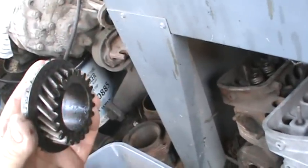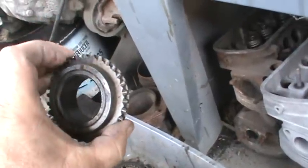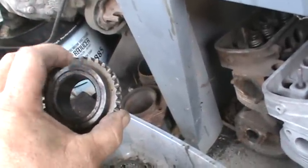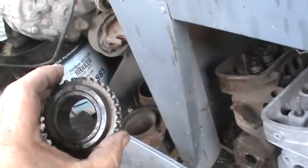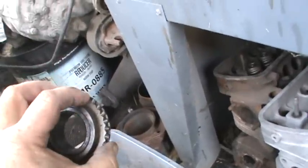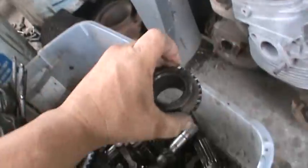If the gear actually drove the car, this wouldn't be an issue, but actually these teeth are what are driving the car. So as you increase the horsepower, it makes this slide slip on the hub in the gear, and the car doesn't go anywhere. So we weld that there. These little dogs are more than likely your popping out of gear issue.